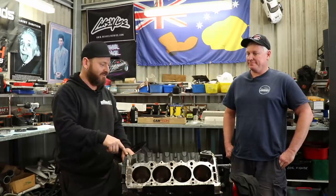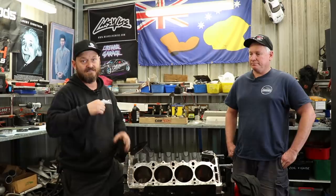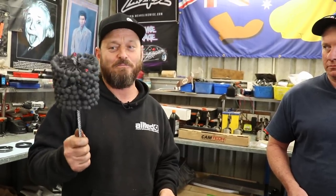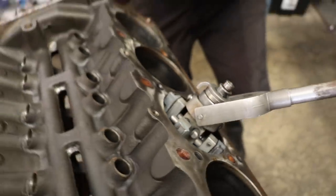This is straight out of Alcock's dishwasher. It's got a little bit of surface corrosion from sitting around, but we'll clean that up. We're going to start with honing. To do the honing today, we've got a flex hone. When we did the VL RB30 engine, we used a tripod stone hone. I bought this one for that job but it was too big — you've got to buy them within ranges of bore size, whereas the three-pronged hones spread to a wide variety. John has brought along his Sunnen hone, which is a professional tool, and he's going to explain which one's better and why.